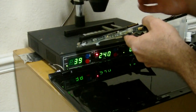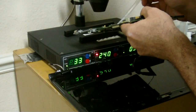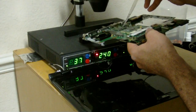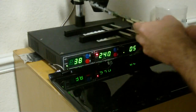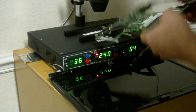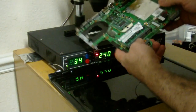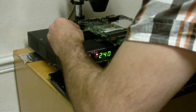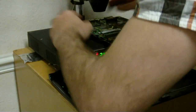Pull this up — maybe you guys can see my liquid flux. It's alcohol based. We have some no-mess flux. I just do it until I see it peek out on the other side. I just rock that back and forth — this ensures that I get a good flow.